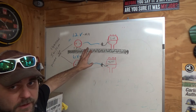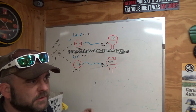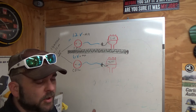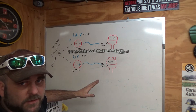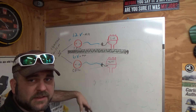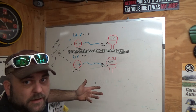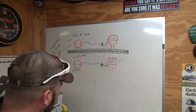Remember, if you're converting from 6 volt to 12 volt, you're going to reverse all of this. There's a bit more involved in a full conversion — you've got to redo the charging system, get a new regulator, because it's going to be working the wrong polarity. But for right now, we're just talking about the ignition system. On the forward front mount distributors, it's kind of the same thing, except the coil is not in the middle of the circuit — the coil is at the end of the circuit because it's mounted on the distributor.